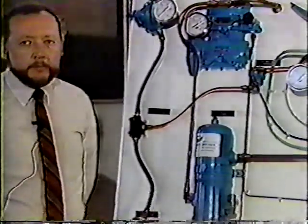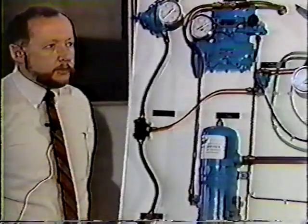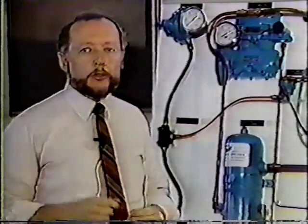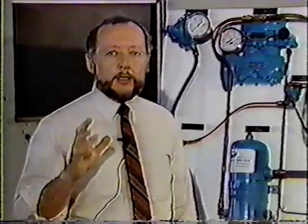The first thing I'd like to mention is there's a mistake that's in the industry today. When you say 121, you think of anti-lock or computer brakes. That was written out of the law back in the 70s, so most people think, well, 121 is no longer with us. This, however, is a 121 system, and any vehicle that you've worked on that was built in the United States since 1975 is a 121 system. You can have a 121 system and not have anti-lock.